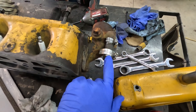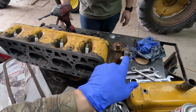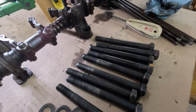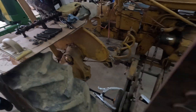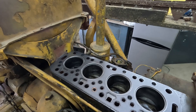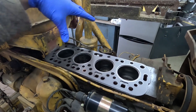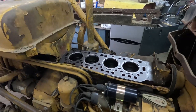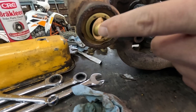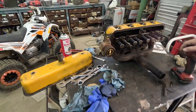I also decided to replace this piece of tubing because it was about to split, and it would be annoying to change it afterwards. Got the bolts all cleaned — cleaned all the threads and wire brushed them a little bit. Both surfaces are completely prepped, and we'll be able to tighten the bolts and get it centered exactly where it needs to be. I also took the thermostat out, cleaned it, and brushed it off. It's kind of amazing how nice it still looks.